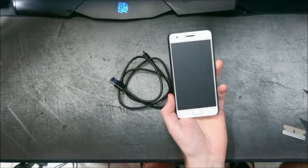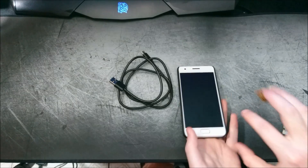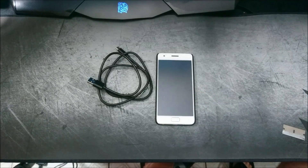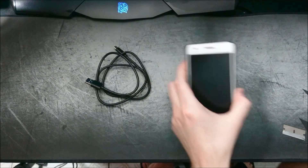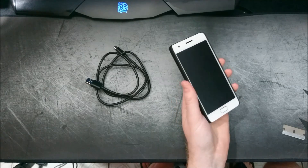So apparently what happened was, what I forgot to do was when I flashed MIUI, it also flashed a different variation of TWRP from what I used to backup the AOSP Extended ROM. So because it flashed the recovery in MIUI, I just changed the language to English, never really thinking twice about it. I left that same recovery, copied my AOSP Extended ROM onto the device, and restored the ROM, and went to go reboot — and boom.